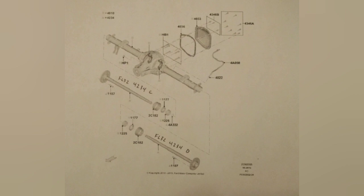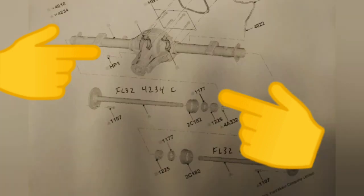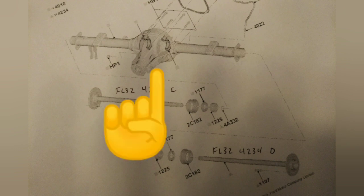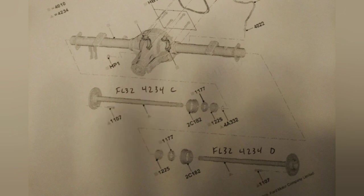When you look at these axles, there's a light duty internal axle, a medium duty, and a heavy duty. The light duty is in the 8.8s. The medium duty is in 975s that don't have max tow, no tow at all, no max payload. The shell of the axle — the tubing and the case in the 975 — there are essentially two cases on a regular F-150: one that has a fitting for the electronic locker and one that does not.